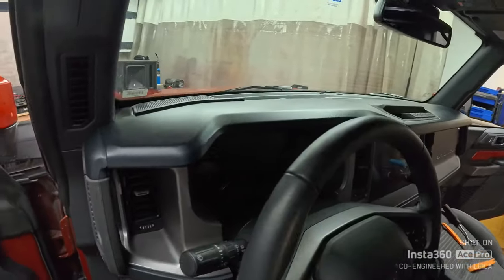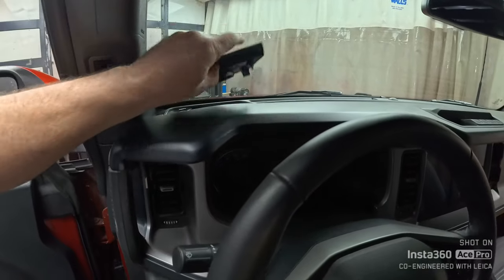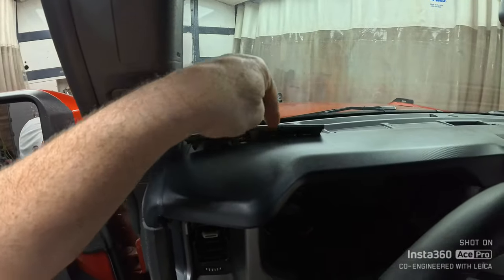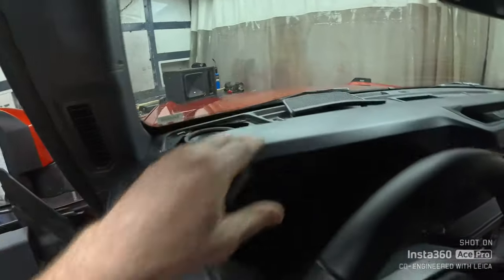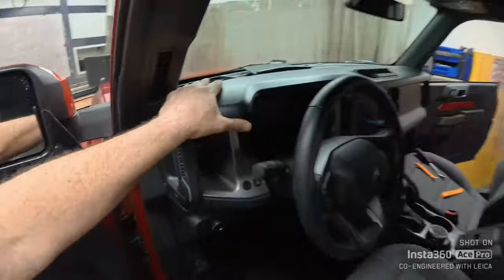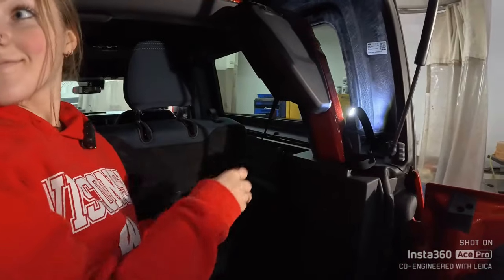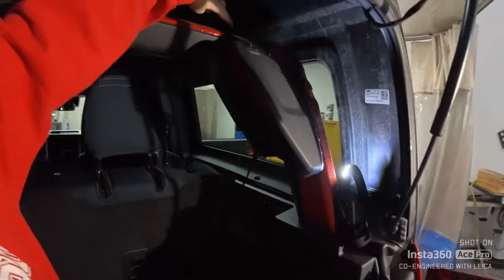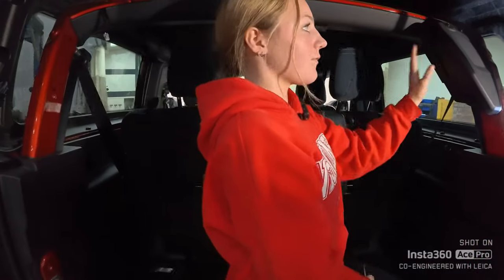So we're in here on the dash. This is a 2023 Bronco, but they're all pretty much the same. We just have push-in clips here, so basically just get behind down in there with the plastic remover tool, pop it up, and work your way around it. Pop that aside — that's going to give you your speaker access. As far as the back pods, Cam is back there working on those. There's a T27 torx here, and then two all the way up here. And then you just take the whole thing off, pop the plastic cover off, and then unplug it.